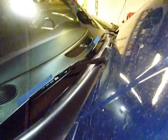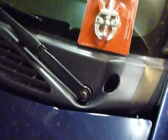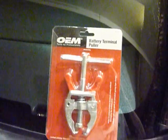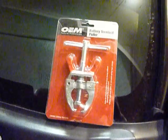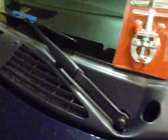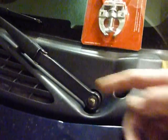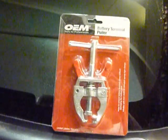Next step, I'm going to put the hood down and we're going to remove the wiper arms using a battery terminal puller. So I tried this a few weeks ago using screwdrivers to get the wiper arms off and it was not happening. So I went out and got me one of these trusty little guys — battery terminal puller. I know it'll work on these wiper arms. This was like $10 or so; got it at Pep Boys. Any major auto parts store will have it. So now we're going to use this to pull up the wiper arms off the nut.